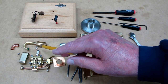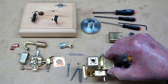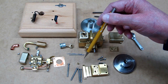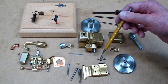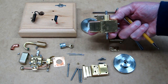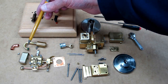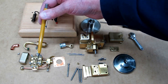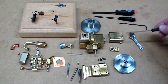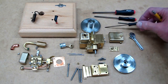But because the exhaust pipe is in the way, you first have to deal with the engine being mounted onto the base. You have to reach in and take these long screws loose, release the base — these screws come in from the bottom and attach this to the engine block. Then you can remove the exhaust pipe, get to the four head bolts, take the head off, take the rear cover plate off, reach in with a 1.5mm allen wrench and loosen these up, and push the piston out.